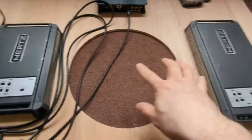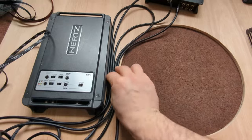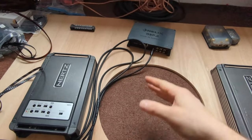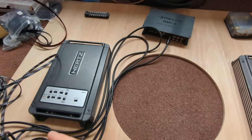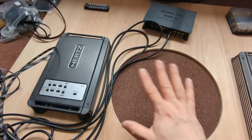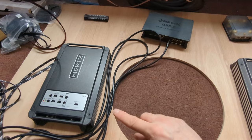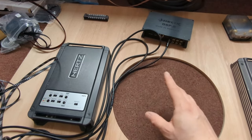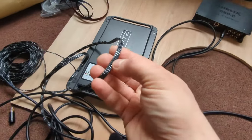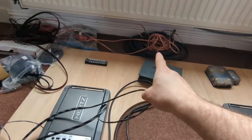I'll keep them symmetrical, so the five-RCA side will have a specific gap and the amplifier will be positioned close to them with no gap between the RCAs and the amp. The plan is to use no zip ties at all. Instead of zip ties I'm going to be using super glue - same as my previous install. There's no issue with this: if you want to replace a wire you literally just peel it off, because if you're using braiding the super glue is on the braiding and not on the wire itself. I'm planning to braid all of them apart from the speaker wires, which are cheap and can be replaced easily.